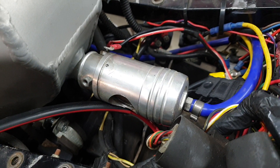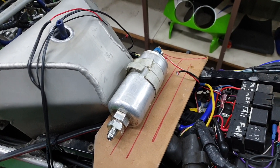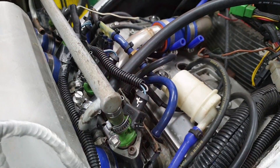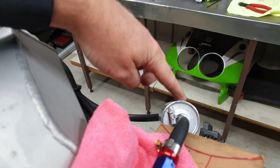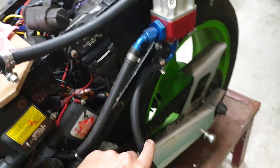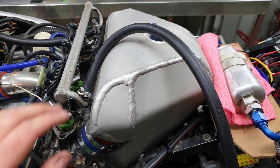I bolted the blower valve back on so nothing goes into the hole it connects to. I'll just seat the fuel pump on this piece of wood — that's as far as I can get it away from the bike while the leads will still reach. So: fuel pump, filter, high pressure, all the way up to the fuel rail. Fuel tank, pre-pump filter, pump, high pressure filter, fuel rail. This line here will return back to the regulator.